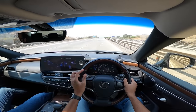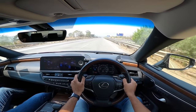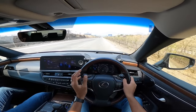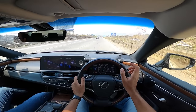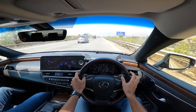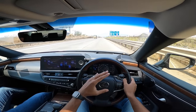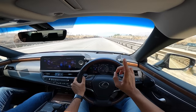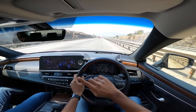There's a CVT rubber band effect under full throttle - revs hit around 5,000-6,000 RPM and the gearbox catches up. This is a complex hybrid mechanism: a 2.5-liter four-cylinder petrol engine on the Atkinson cycle - the most efficient combustion method - paired with a hybrid battery. The engine produces 178 PS and 221 Nm of torque, while the 1.6 kWh nickel-hydride battery produces 120 PS and 202 Nm.